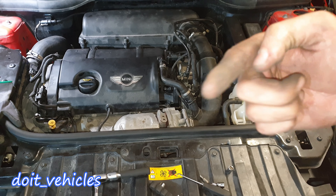From this point you can basically remove the gaskets if that's your concern. You don't need to remove the whole intake manifold — it's still attached to the throttle body and some other components down there. To unplug this connector, press on this tab outwards while you take it out. And down here you've got a wiring harness which you gotta pop out.